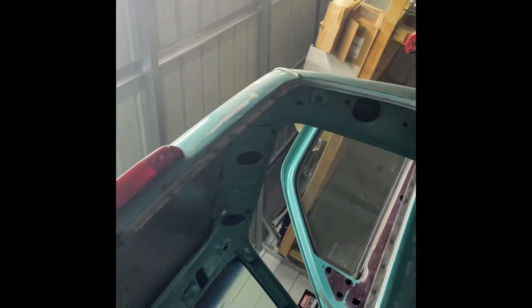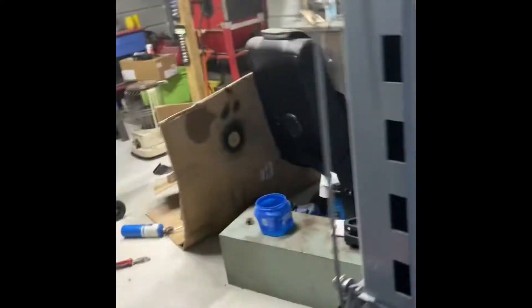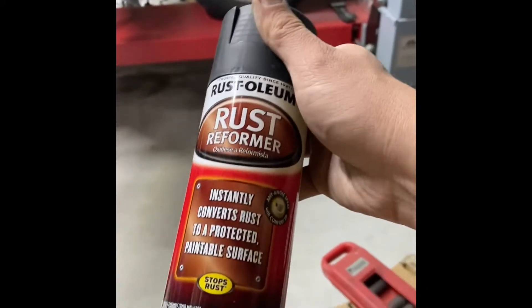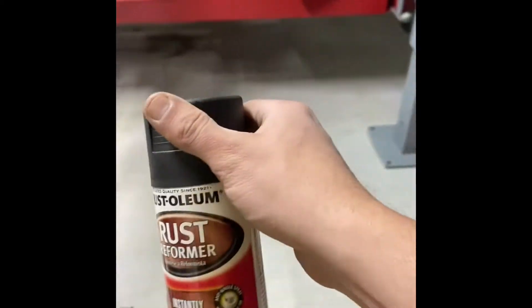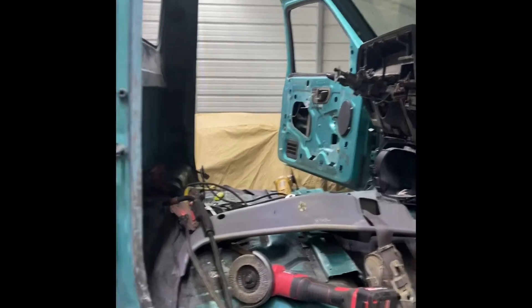It's a little rusty — I think it's actually been leaking for a long time. What I'm going to do now is spray that with some primer and then a protective coating. I'll show you exactly what I'm going to use. I've got the Rust Reformer — if there's any rust in there that I didn't get to grinding, that'll hit it. Then we'll hit it with acrylic enamel, semi-gloss black basically, to give it some coverage so I can drive it over the winter and it's not going to rust until next year when I get around to painting.